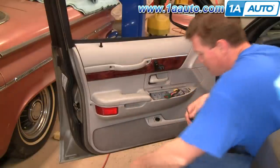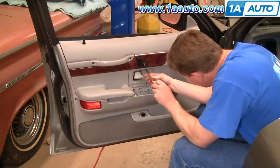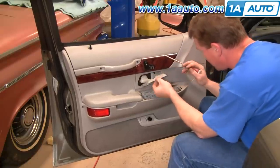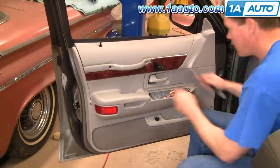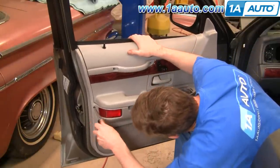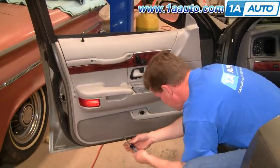Pry out down here. If you're going from the bottom and you do scratch something, it's more difficult to see. Put your screwdriver in up top — you can actually see a little space where the screwdriver goes — and pry this bezel out. Now there are five Phillips screws to remove: one there, one there, there, one right there, and one right down here at the bottom. As you're turning them counterclockwise, you might have to reach in with your fingernail to pull them out.